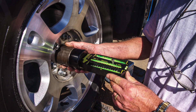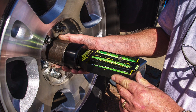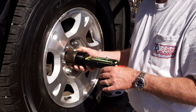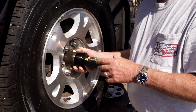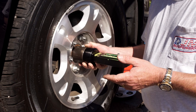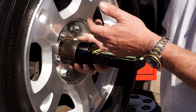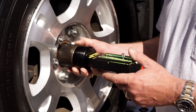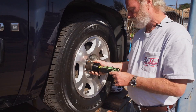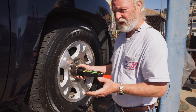On camber we're going to be working in tenths of one degree, so the camber has to be accurate — not so much caster, but camber we have to have accurate. For me, I like two tenths negative — that's two tenths of a degree, it's pretty small. You can set it at zero, plus one, or minus one. Remember, you have control over it now, so you're going to be able to set it up the way you like it. I like two tenths; that's where my gauge is, everything's great.